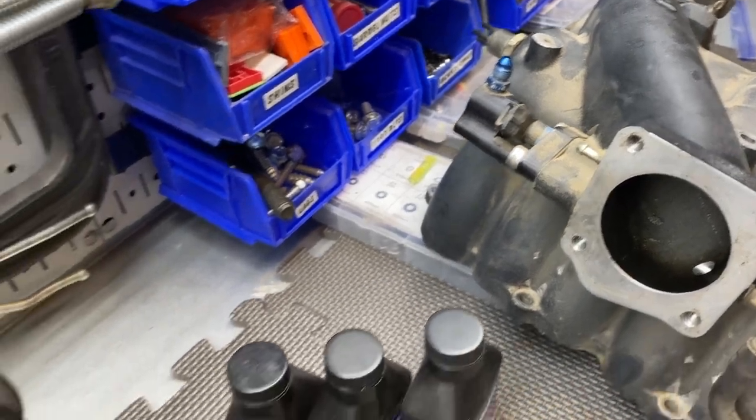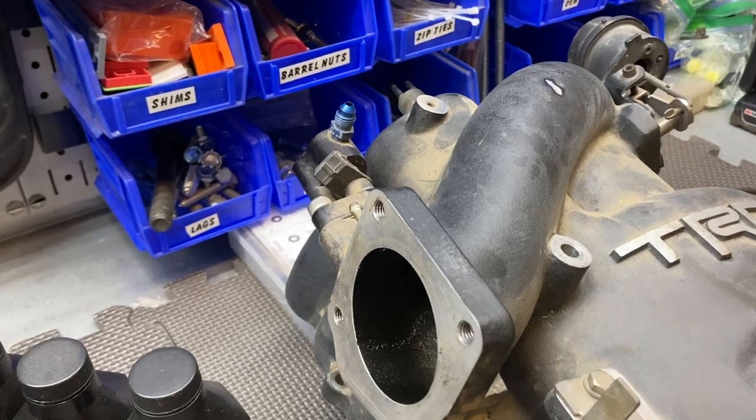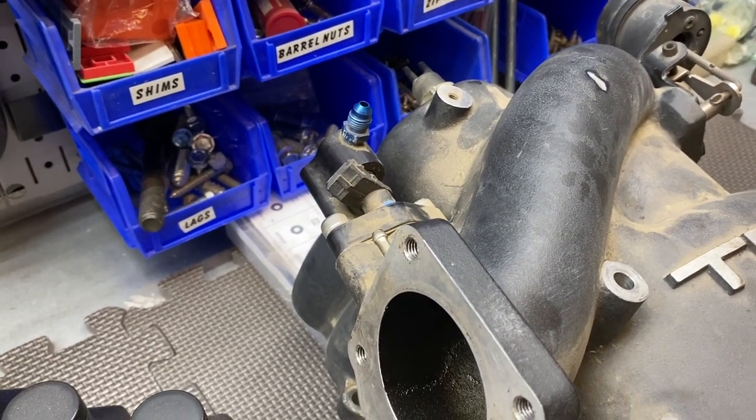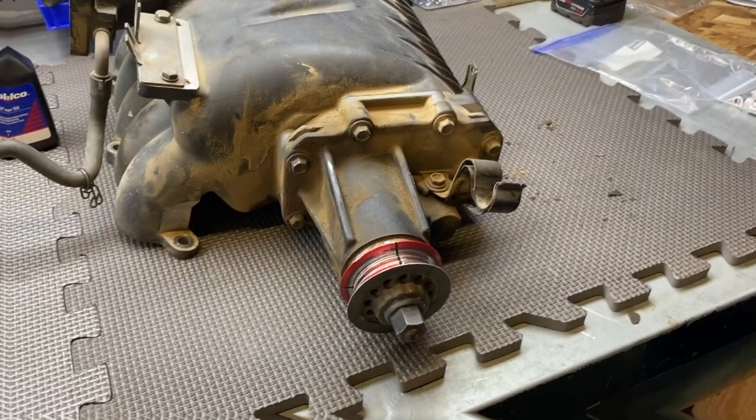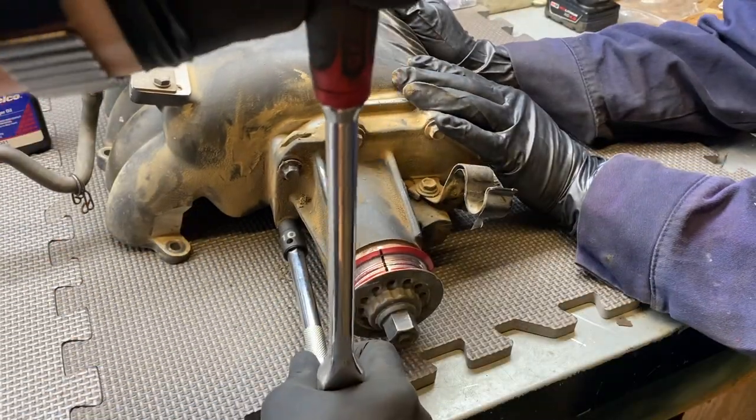Another item you'll want when rebuilding your supercharger — or even just replacing the oil — is supercharger oil, this one made by AC Delco. You might also notice Stevo has an extra fitting on the back side of his supercharger; that's his URD seventh injector. We're going to be tackling that job soon, so subscribe so you don't miss it. First step: remove the nose cone, which is held on by 10-millimeter bolts.